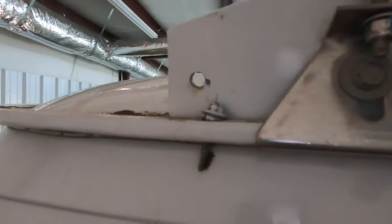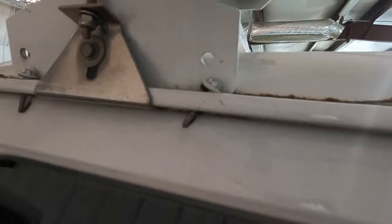Now, there's a couple spots where this roof rack, when it was installed, they just screwed through the rails into the rain gutters, and so I'll probably need to patch that with some Bondo, sand it and prime it, and then that'll be ready to be fixed along with the rest of the paintwork. So yeah, let's get this yanked off. I'm gonna sell it on Facebook Marketplace and see if we can offset the cost of some new roof racks.